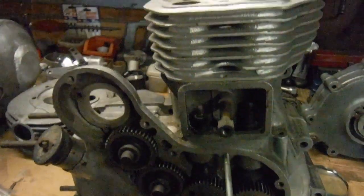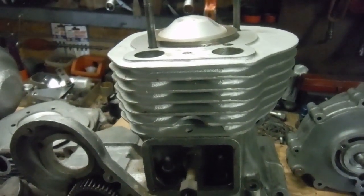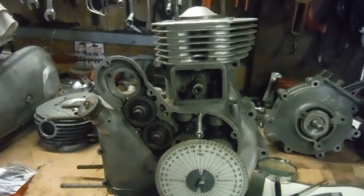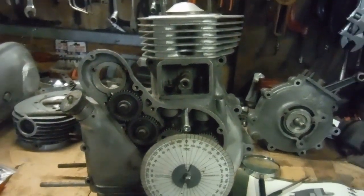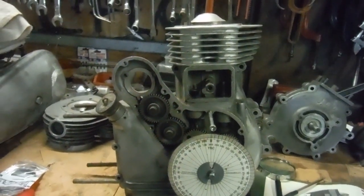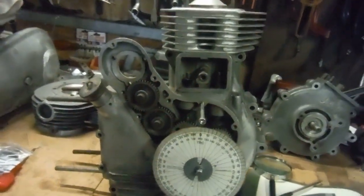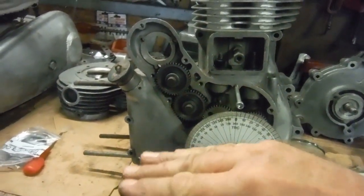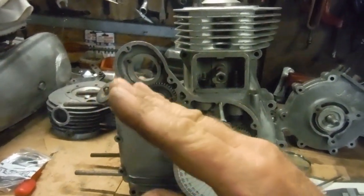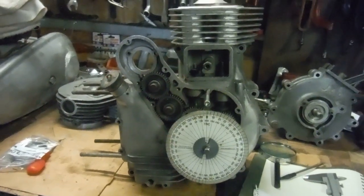I think a lot of the benefits come purely from the inlet valve shutting later, when the piston is much further up the bore on its compression stroke. So it's building up less pressure and less resistance to rotation — there's less effort applied against the engine trying to slow it down and stop it. The piston is pushing and compressing the gases, and that is slowing the engine down and taking power out of it. By closing the inlet valve later, you're reducing that effect. Also, the connecting rod has a longer dwell period as it comes up around top dead center, giving it more leverage against the very high pressure as it builds to maximum just before firing.